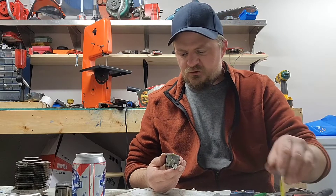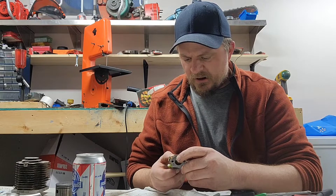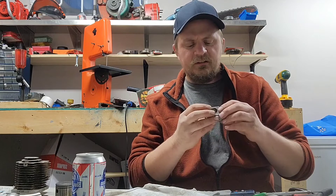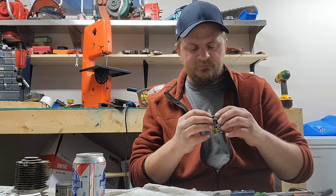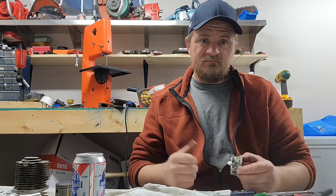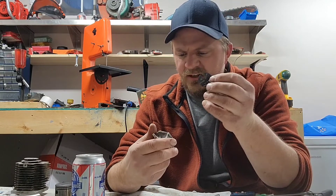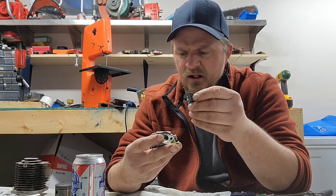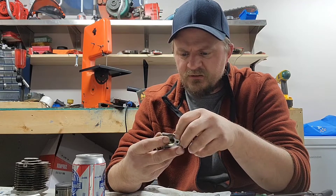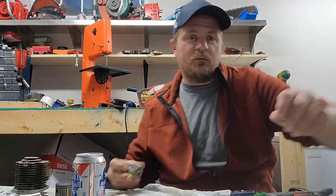This is kind of an 'I don't know' situation because everything seems to be okay. It's clear. Could this be the fuel filter? I can't believe how dry this gasket is. Assuming it's the right gasket, I can put this back together and check the fuel filter.